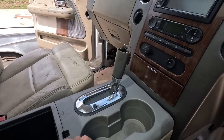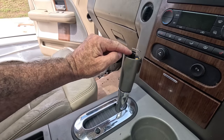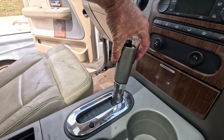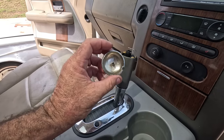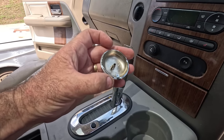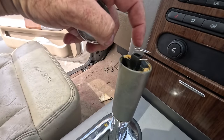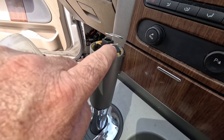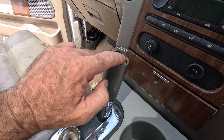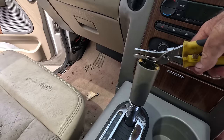So we're almost back together, and you can see my button's working now because there's a little spring that goes down inside there that depresses that lever down, which activates that button. But it's normally held in there, and there's two little clips. Well, there used to be, now there's one clip and it's broken. So you can see somebody's had a go at gluing it on. I've made a little circlip. I pierced a little hole there, a little hole there. So I'm now just going to snip off the edge there and leave that little clip in there, you know, makeshift kind of circlip. There we go.